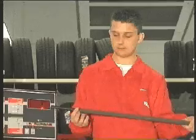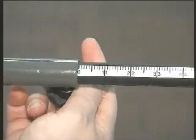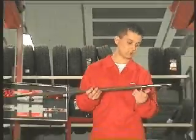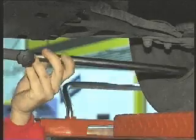We are now demonstrating the track compensation measuring process. The numerical gauge must be set at zero. Then the opposite end of the shaft can be released. For the front wheel track measure, the operator puts the rod between the two lower internal rim borders of the front wheels.